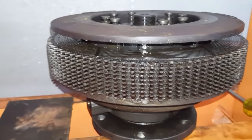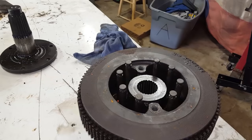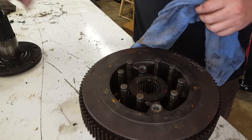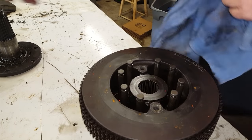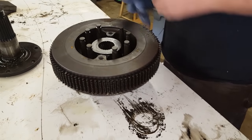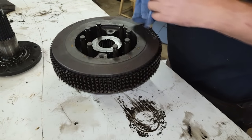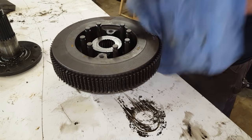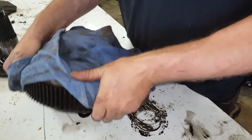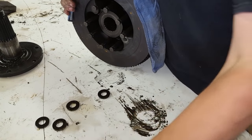I'll move this over to the bench and we'll disassemble all these clutch plates, then get back on the press — I need to replace this bearing. I'll just press this guy out. Stick it on the press — it took a lot of force to get that out; I think they said it's on there like 20 tons of pressure or something. But that's what we're left with. Got a little bent ear right there from something. Flip this guy over. These are all the little spacers from the bottom of the springs — make sure you don't lose those.